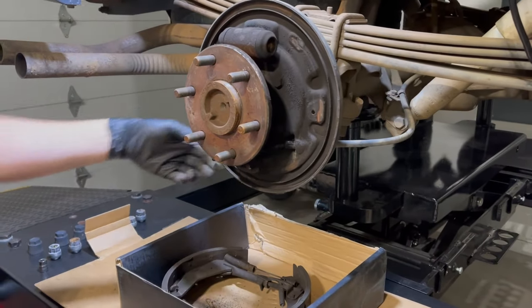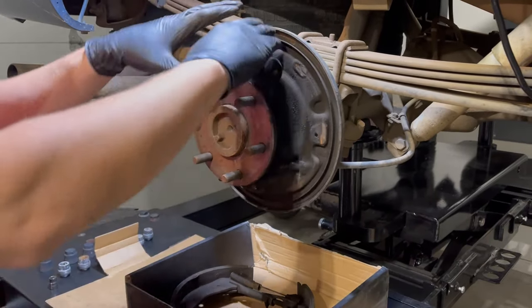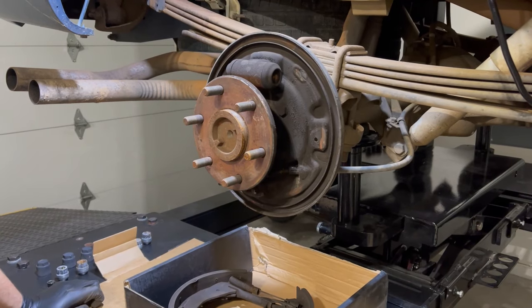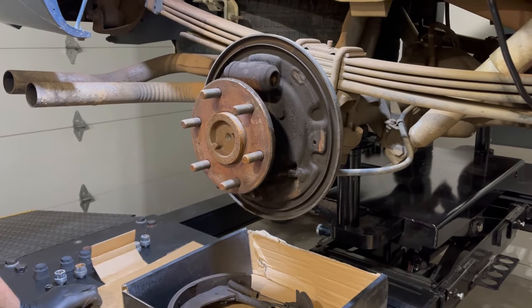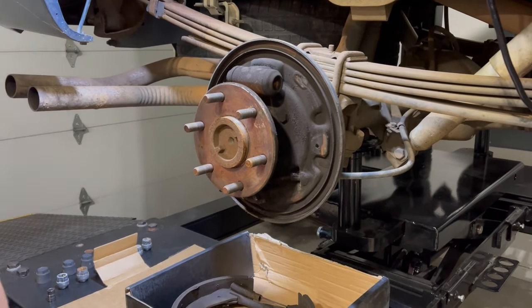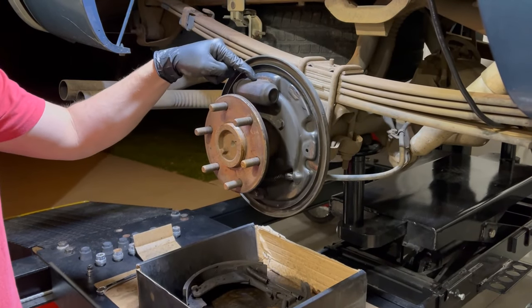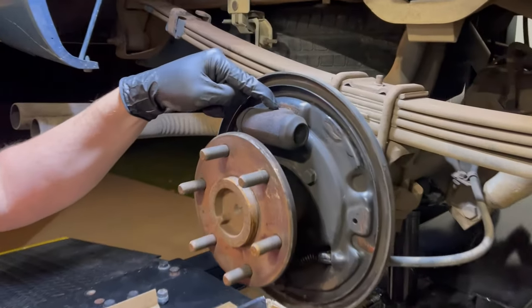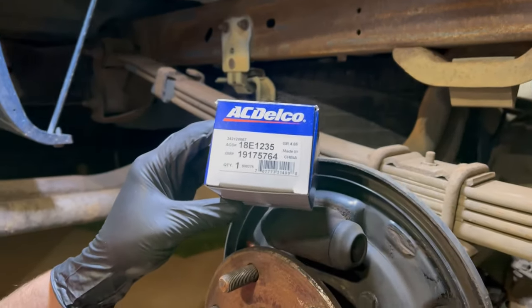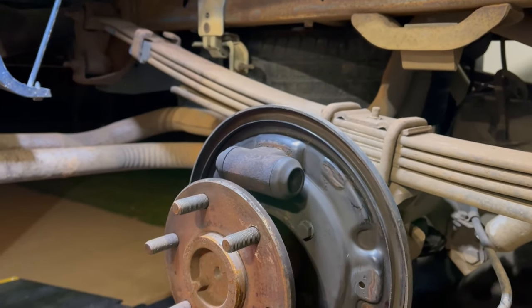Really the only spring we had to fight with was the emergency brake cable. Next step, we're going to get some brake cleaner and just hose down this whole area — with drum brakes everything gets pretty grimy back here. We'll clean everything up and then pull the wheel cylinder off and start putting on the new parts. We're replacing it with an AC Delco wheel cylinder — that's the part number there for you.